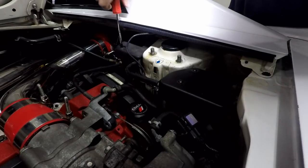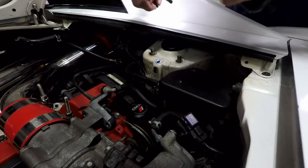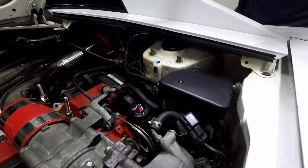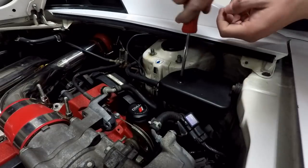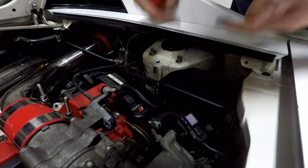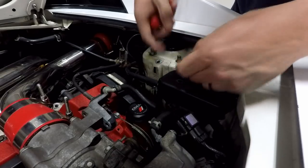Let's see if that comes out - yep, it's coming out. There we go. This is the damn thing that's in there to hold on a plastic cap - that thing's in there boys. They're supposed to be magnetic but apparently this lost its magnetic properties. So let's see if this pops off - in there it does. Before I remove this cable, I'm going to go ahead and tell you - these two bolts right on top here, there are two screw-style bolts that need to come out. The only reason you need to take this cover off is there are three 10-millimeter bolts you need to pull this out - two here on the side and one that this cover blocks. So once I take this top off it'll give me access to it.